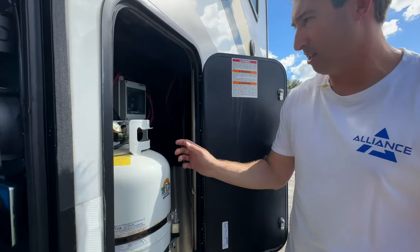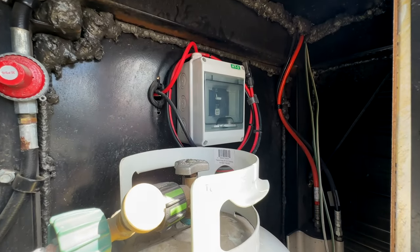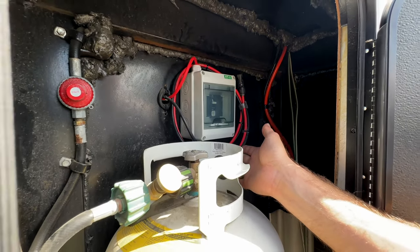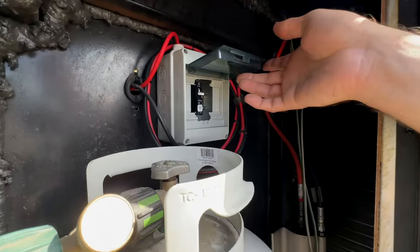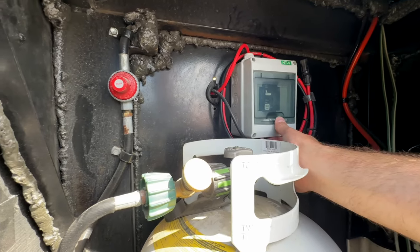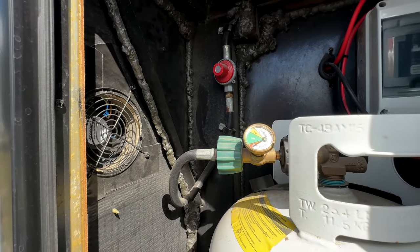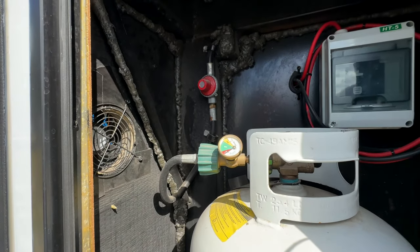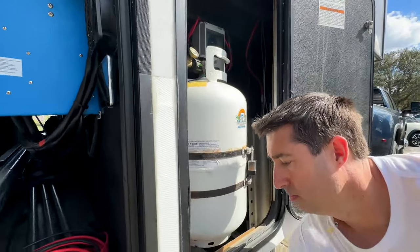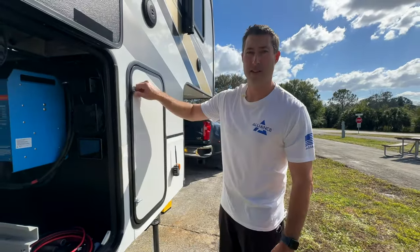In our propane bay we have some secrets. This is the other side of the battery bay. We have one MPPT dedicated to our deployables — these are the PV cables. There's a waterproof box with a 30-amp breaker so we can control power going to and from the MPPT without shutting down the whole system. We also have the exhaust for the four-inch fans venting the hot air out — it works like a charm.